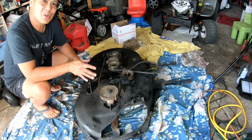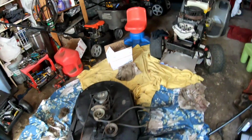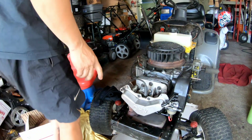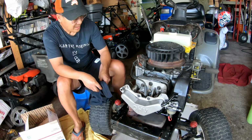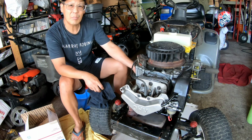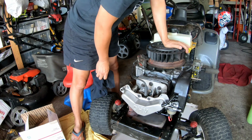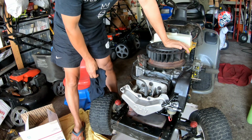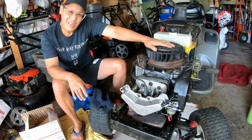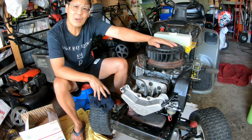So it's been about an hour or two. And during that time, I decided I was going to put the engine back again. I mounted the three bolts, right? And I put the muffler back on, wiring harness back on, starter wire, positive wire back on, throttle cable, fuel line back onto the carburetor. I put two new cardboard pieces underneath, and there are no drips. Great. So maybe we fixed the oil leak finally.